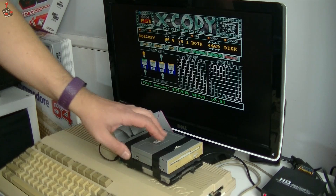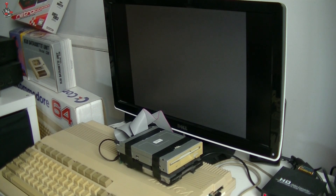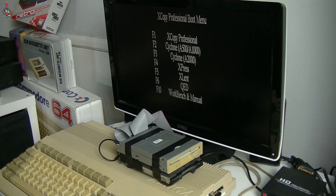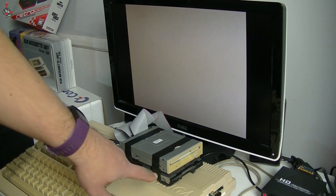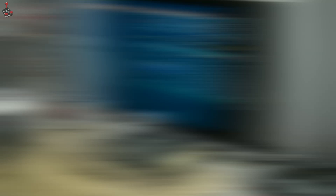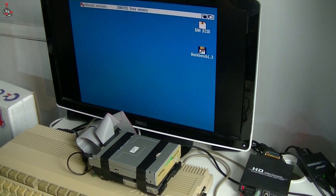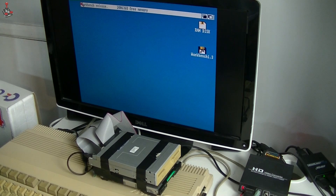I've just had to tape them up. If I then do a soft reboot and boot into XCopy again via the GoTek, you should be able to hear this one starts to click. And we should get detection. There we go — that one's clicking and this one's detecting. As you can see, you need to do a full reboot for this disk to be detected. But now it is detected. Once you take it out, it gets detected every time. If I put it back in, the disk's detected. If I put in a second drive — the PC floppy drive — it's also detected. It works really well.